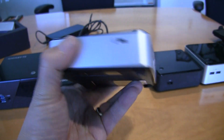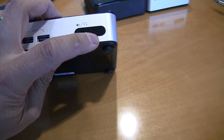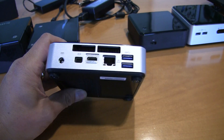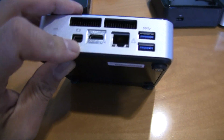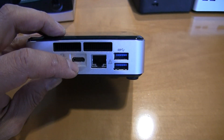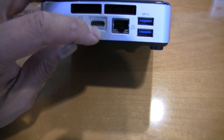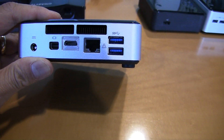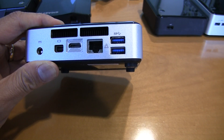This is basically a miniature computer. I'm going to walk you through the outside: two USB-3s, there's actually an infrared port behind here, headphone audio out, analog, Kensington lock port, two ports for the fan, Ethernet, two more USB-3s, mini DisplayPort, as well as mini HDMI. On our unit, they actually had to mill out this little bit of aluminum — these were early press samples. Apparently some mini HDMI cables would not stick in there unless they milled it out, so the retail units actually do have that milled out as well.